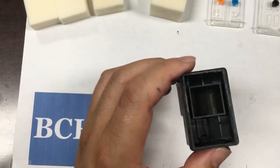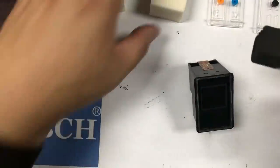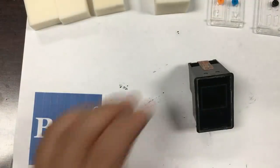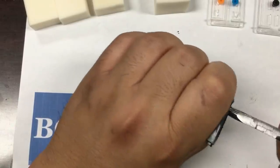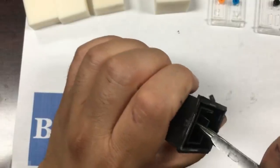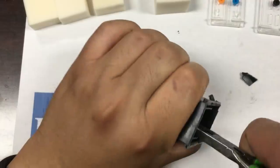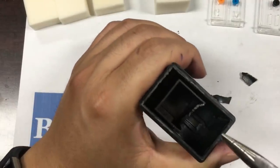In the next step, we need to get the ink flow into the filter. What we do is use the long nose plier and open up the wall so the ink outside the wall can flow in. Make sure when you do this, do not damage the filter on the bottom. You don't need to remove the wall completely — as long as the ink can flow inside, that's fine.